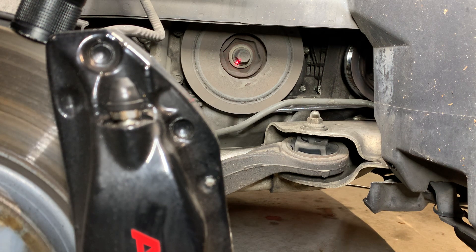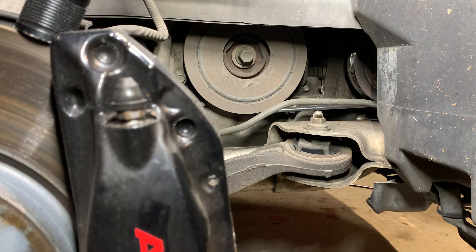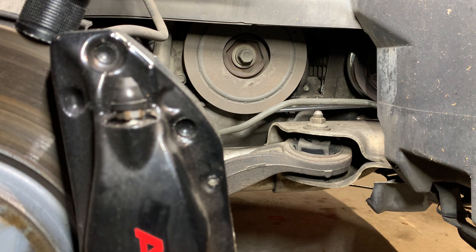It's a lot, and this stuff gets rusted and corroded. So if you're going to do it yourself, how do you tackle that? You need to prepare yourself for the job — set yourself up for success. There's a method and different tools. There's a special Honda crankshaft tool you put in to hold it from spinning, and you can't just wedge a breaker bar in the lower control arm to stop it from turning.